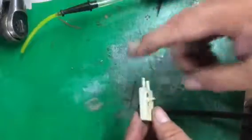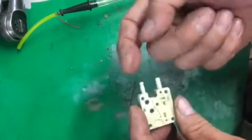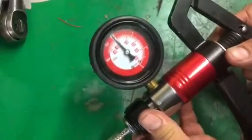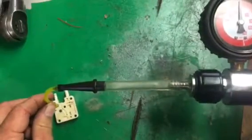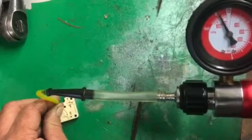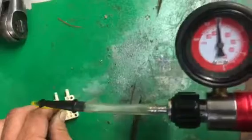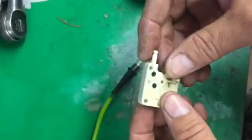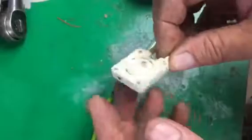So I know both of these check valves are letting air go through them in that direction. Now I'm going to check and make sure both of these are working to keep air from coming back the other direction. For this you don't need the stethoscope — you're going to watch your gauge. Switch this to vacuum, hold this down over the first one really tight and create a vacuum on it, and it's holding vacuum — you can see my needle is not moving. That check valve is working. Moving over to the next one, hold it down tight to seal it, and that check valve is holding vacuum too.